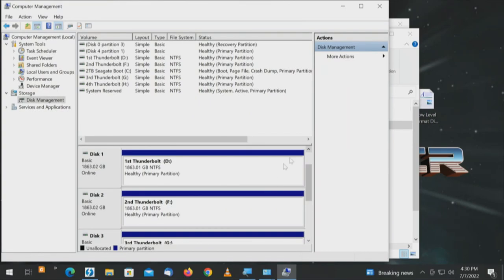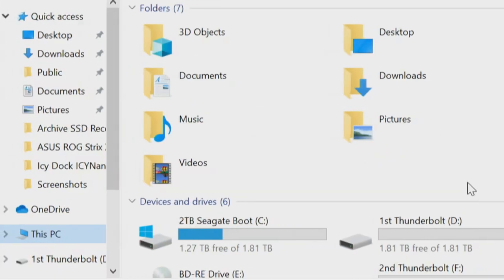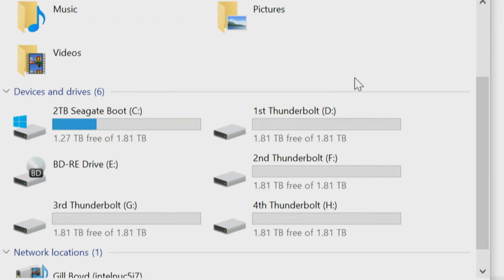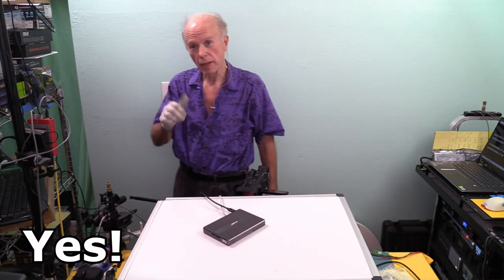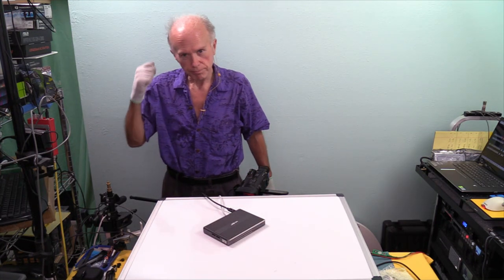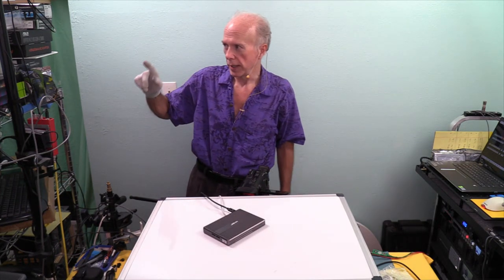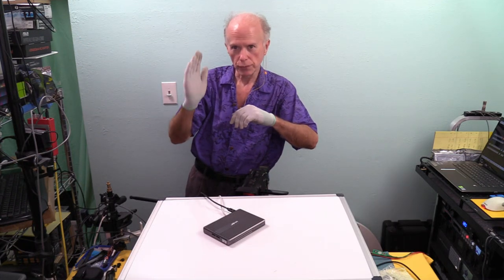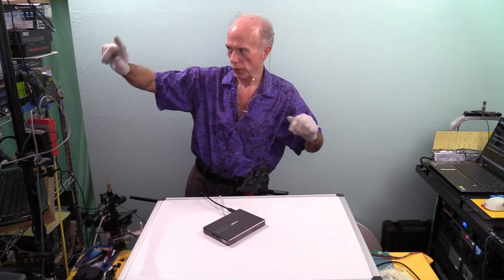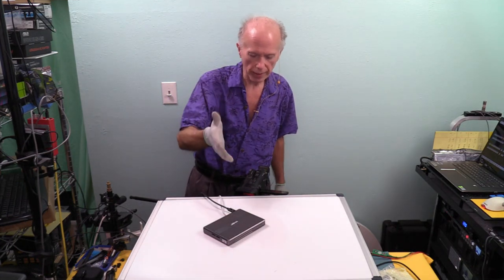Apparently when I started running this, the order of the day was patience, persistence, and perseverance — but number one, patience. Just wait until the whole thing enumerates and comes online; that was the issue. We're used to everything happening fast. We have four drives to test. One of the questions as I go through the outline: as we test the four drives, we can do heat and speed because SMART information passes through, so we're able to see how that works. I'm going to put the two applications up on screen.